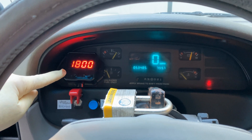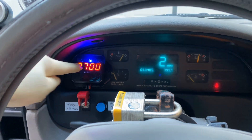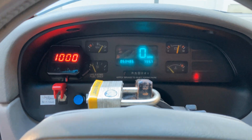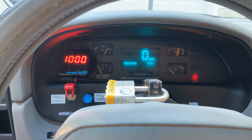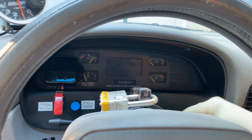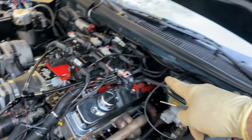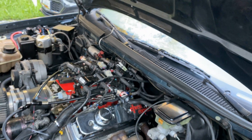Now check this out — I'll go up to 3500 RPM. The window switch activates. Another neat thing: it lets you know that it's active. You can set it to any RPM setting you want. Anyway, this is the system that I want to put on my own car — very simple, well, except for the direct port, that is not very simple, but the nitrous arming is very simple.